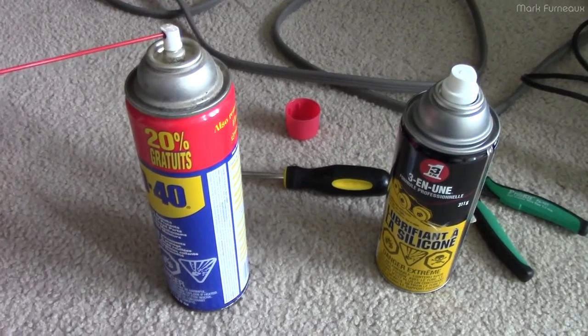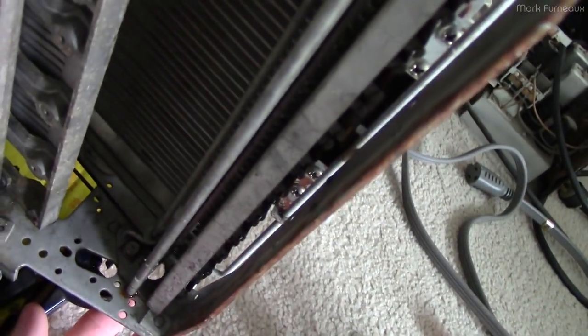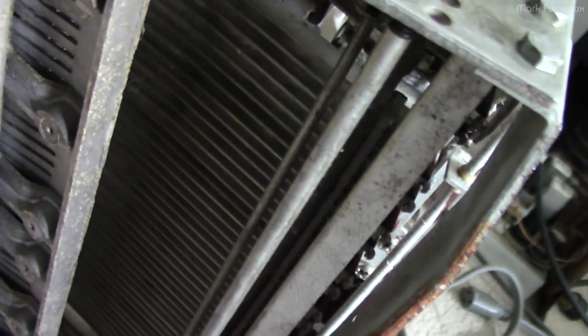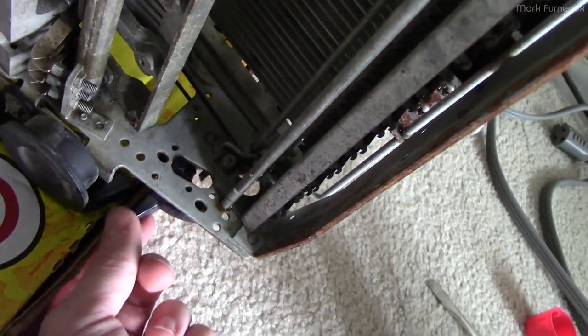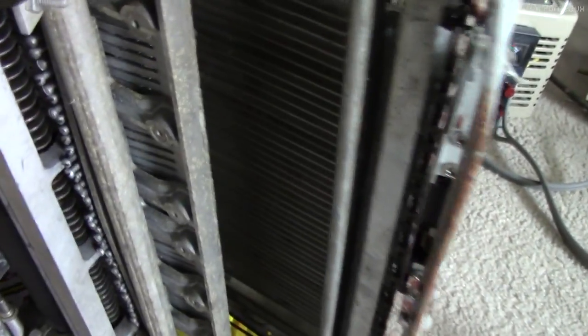I got probably the oldest can of WD-40 I've ever seen and some silicone lubricant, and I've worked it into all of the points along the key lock mechanism. After probably a hundred or so actuations, it now operates under its own power - it works perfectly. I'll just have to reinstall the switch and I should have a fully working on/off mechanism as it was intended.